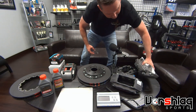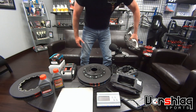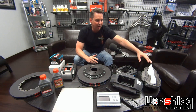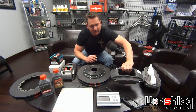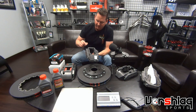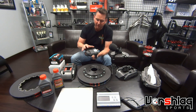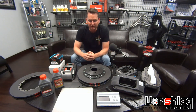It's a Brembo part — Brembo designed this system. We've talked at length with a former Ford testing engineer who worked on the S550, and he explained why the caliper for the 14-inch 4-piston S550 is so much bigger than this one. It comes down to cost. This crossover tube — they did it internally on that casting, and to do that they added 4 pounds to the caliper just to save a few dollars. The bean counters always have something to do with compromises.